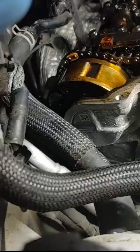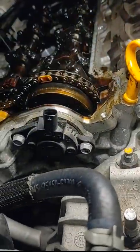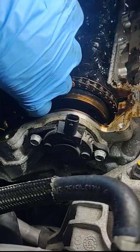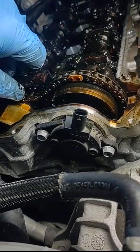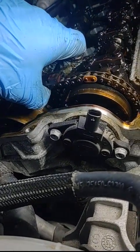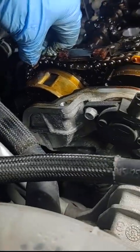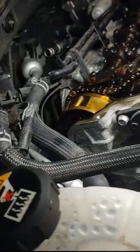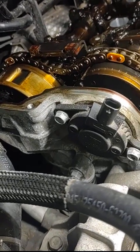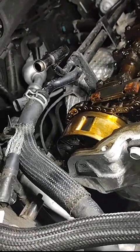The yellow things are the two timing marks - there's an orange one for the rear. When I first pulled it up it was over here, so I go clockwise, but every time I went clockwise this would tighten and loosen. This whole thing is plastic top and bottom, but something is preventing any spring tension. I can actually move it a tooth if I really want to. The tensioner may be held all the way to the other side.